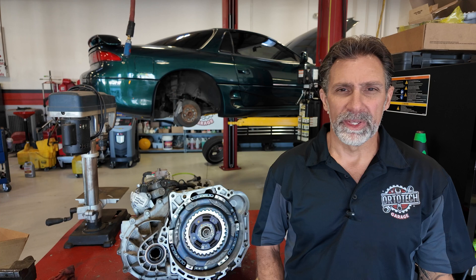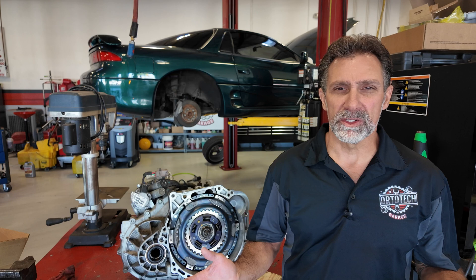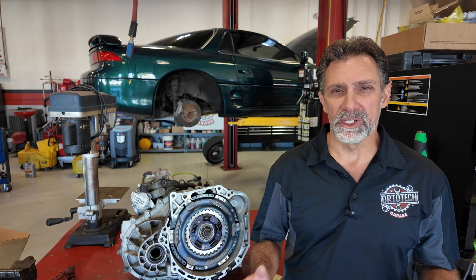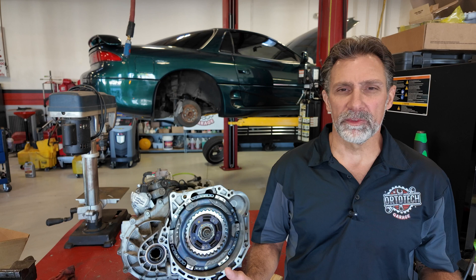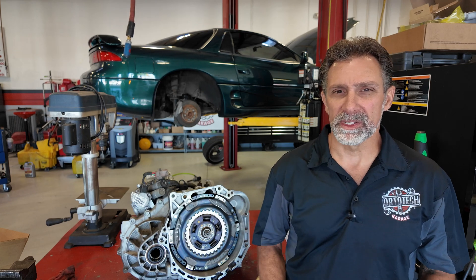Now you're going to see it on a lot of other vehicles. It requires some special tools and special techniques and the cost goes up quite a bit, but it gives you a performance benefit. It's also a little better on fuel efficiency because once the clutch is engaged there's no loss like in a torque converter type automatic. Some of these gearboxes are also quite a bit lighter than an automatic transmission — really just using a manual gearbox with some extra components on top to shift it electronically. So you get better control over your shift points, performance advantages, and some small benefits on fuel economy.